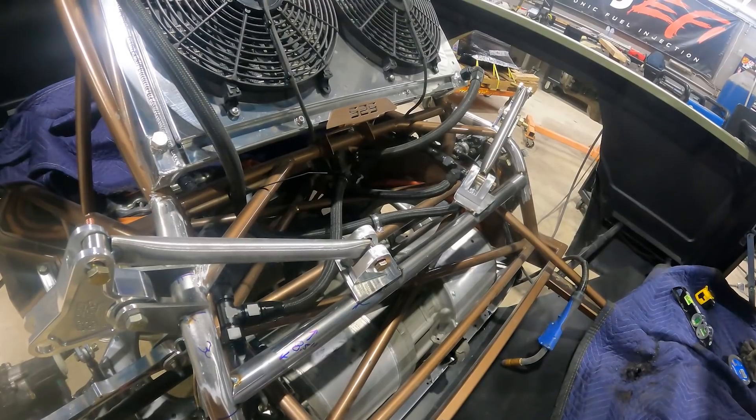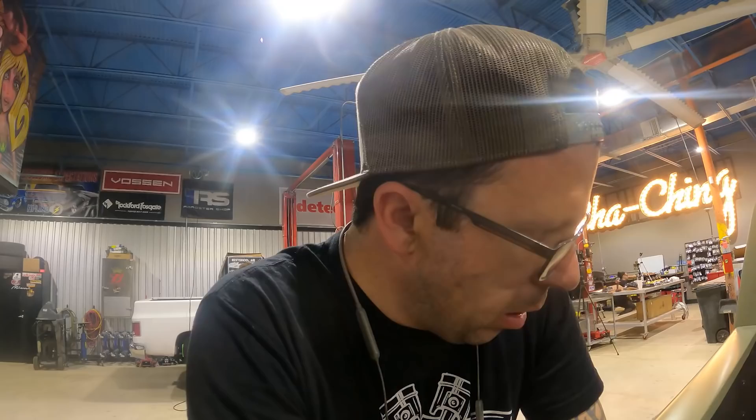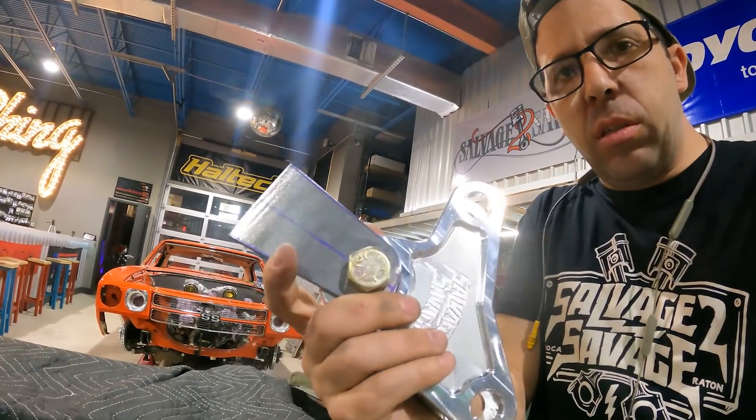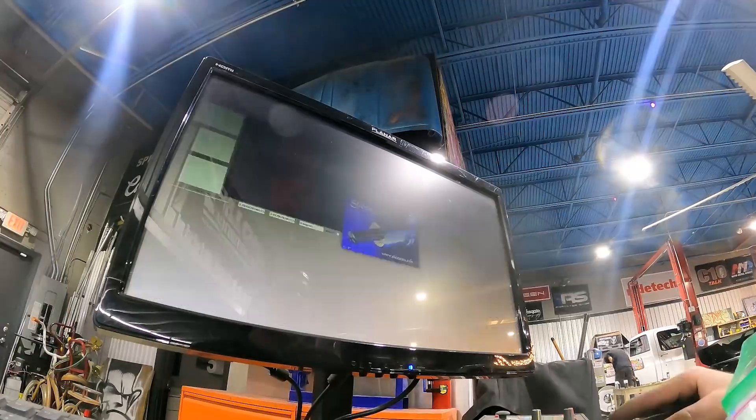The base plate is looking good — this thing's going to look pretty saucy once the coilover's in there. Moving to the front of the truck, I'm going to get the front rocker arms situated and then throw the body kit back on, throw the wheels back on, start setting our ride height, and measure for our end links. I originally cut these tabs at four inches long — they work pretty good for the back, but in order to catch the landing for the shock mount on that crossbar right in front of the inverter, I'm going to have to kick these over on kind of an angle.